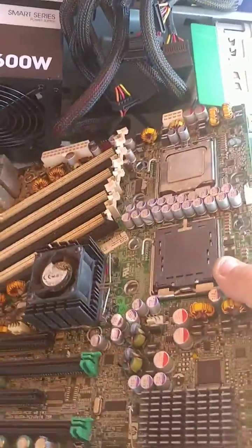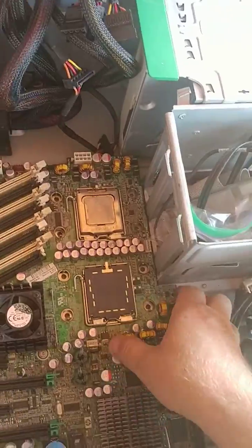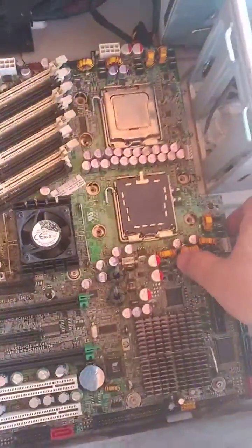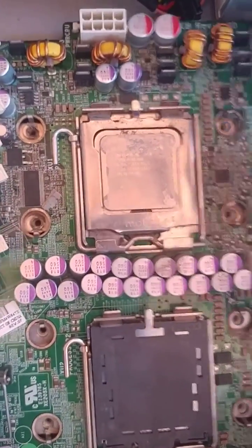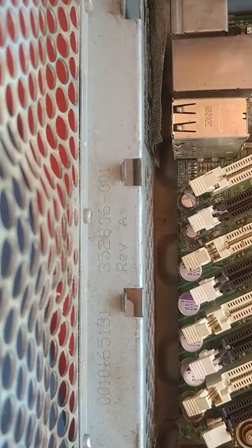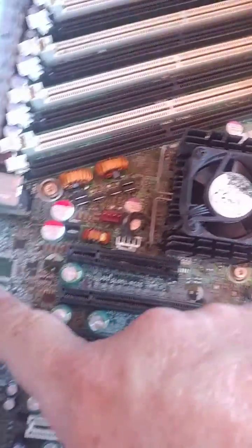Then when you get the replacement board to put in, let's make pretend this is the new replacement board. So we just lay it down in here like this, and just slide it to the left, and it's in. Make sure you align these four holes here where you've got to put the heat sink assembly back in. You see that it just slides to the right and left — you don't have to undo any of these screws here on the motherboard at all.